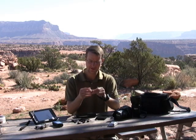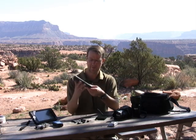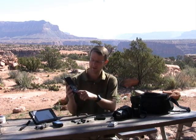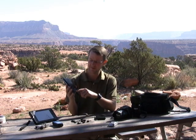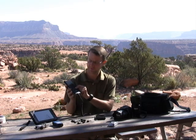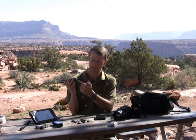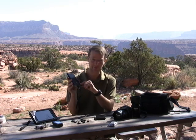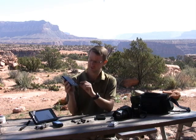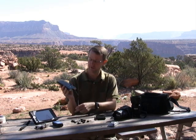Simply plug the tip in — it's a standard type connector. You can plug the power cord into the Techeon, which automatically turns the device on and it comes up at 5 volts by default. With this button here we can select the voltage that we want. The Samsung likes about 19 volts so we select that. The Techeon has a little locking switch, so we'll lock that in so we can't accidentally change the voltage. Once that switch is locked, if we hit the select button again we get a readout on how much battery power is remaining, which is pretty handy.